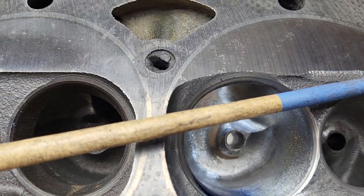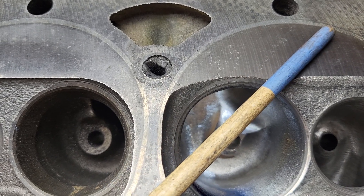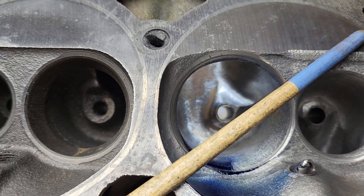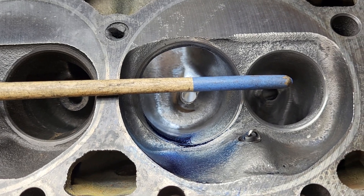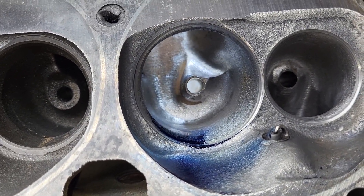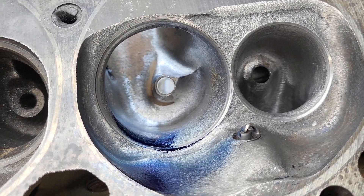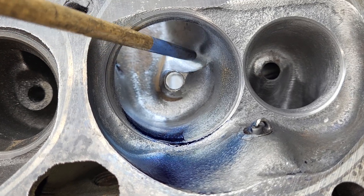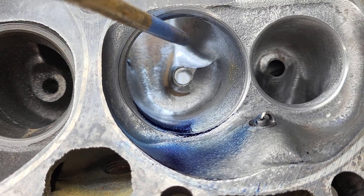Let me see if I can demonstrate this. We were more of an angle like this before, and before that it was even steeper. So I'm starting to turn this down from this position more like 3 o'clock. It's not quite there. I don't even know if I can actually get there, to be honest. I may blow a hole in this first. But when I'm trying to move this over, the burr wants to dig into the wall that way, even if I use the smaller size burr.